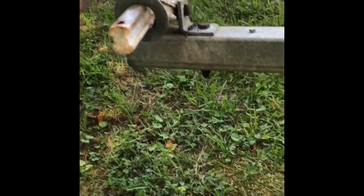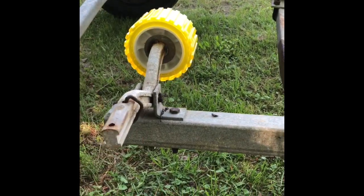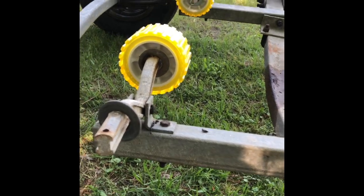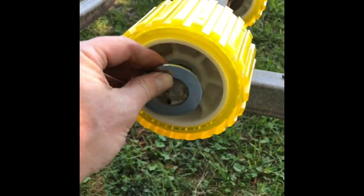Let me show you what I got here. Then you'll put your roller on. The rollers come with two size bushings — they got a great big thick one. This trailer takes the thinner one, so they provide that to you. Put that thinner one on for a one-inch, or one and an eighth inch shaft. Put your roller on, put your new washer on, and then you'll put that hog clip in. I'm going to go ahead and fix the one on the back real quick — replace those, pry it out. Put a better clip on the back. This is one of the washers from the front — see, it still looks nice and galvanized. You'll put your thinner bushing on, put your wheel on, your wobble roller on the washer.